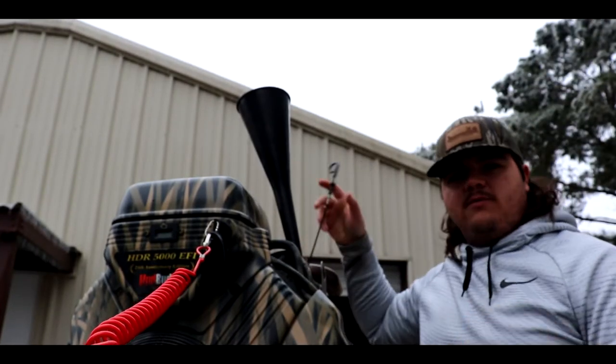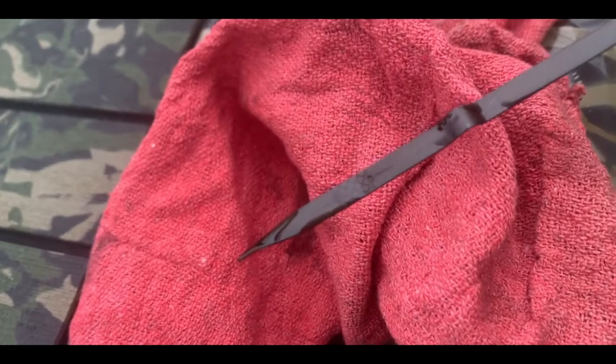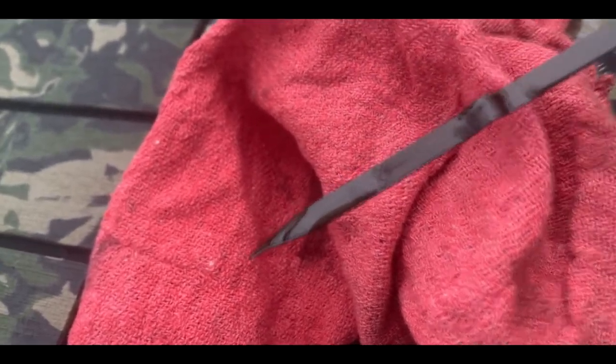I'm actually going to go a little bit over because, I ain't never recorded on my iPhone before, and this damn camera keeps dying on me. I didn't charge her up. See, my oil line's a little bit over the middle of that textured area. So, put it back in. It ain't never been this cold before, so I'm gonna just pour the rest in and make a full 2 quarts, and check it. If it's a little high, it's okay, because once you crank it up, all your bearings start running, which will disperse that oil a little bit more.